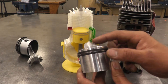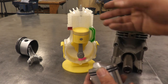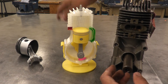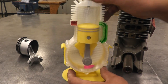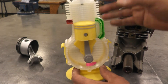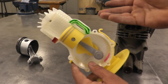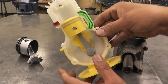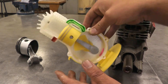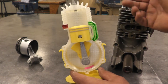This piston is wedge-shaped — I'll explain later why. It plays a pretty big role. Because there's no oil in the crankcase, this engine can be operated at any angle. If you hold a four-stroke engine at an angle, the oil doesn't lubricate the engine properly. This one, because the oil is mixed in the fuel, can be operated at any angle.